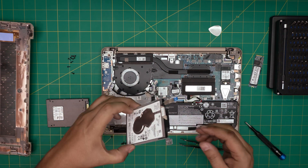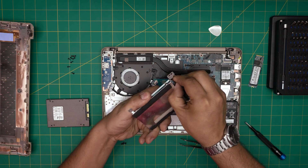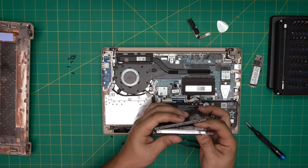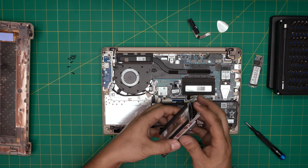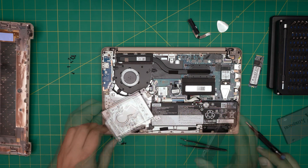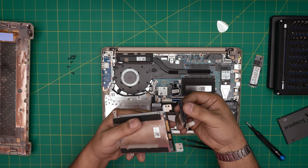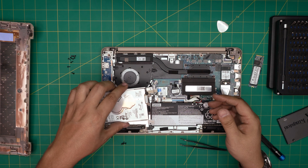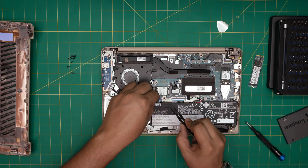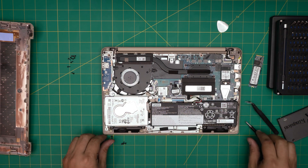Once the screws are out, grab the whole hard drive and bring it up. To remove the adapter, don't yank on the cables — put your fingernails at the adapter on the bottom and pull it backward and it will come loose. To replace the drive, remove the two screws on each side of the caddy, place the new hard drive in the same orientation, and put the screws back. Then push the adapter connector all the way in, bring the hard drive back, align the screw holes, grab the flex cable, slide it underneath and all the way inside the jack, lock it down, and put the four caddy screws back in.